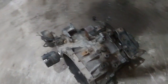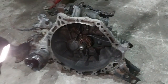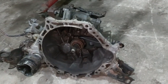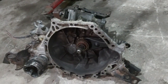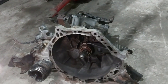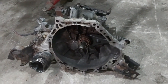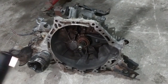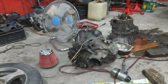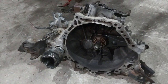The C52 transmission is also bust. It comes from a Corolla with the silver top 4A-GE engine, and we retro-fitted it with a bell housing for a 1NZ/2NZ engine — that was done last year. It has a TRD LSD, but no other internal mods. The previous problem was that fifth gear was cracked; we replaced it with a fifth gear from a surplus transmission. That second transmission is over there, and we're working on a third one.